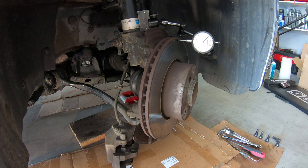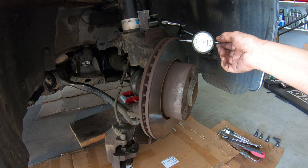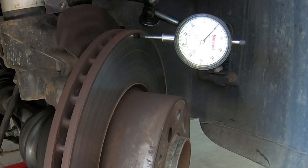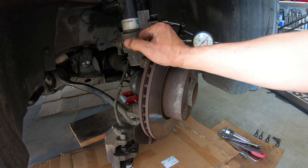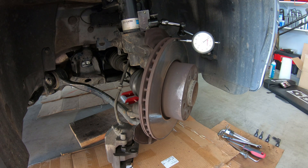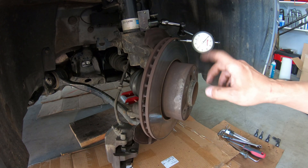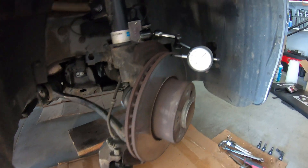In order to figure out what is going on with the brake rotors, you have to attach a dial indicator to the strut and aim it at the brake rotor surface. Indicate zero and give it a spin. Going through 360 degrees, we can observe the needle moving into the red zone. This rotor has a runout of about three thousandths of an inch, which is unacceptable, and I'm guessing that is the reason for the complaint.